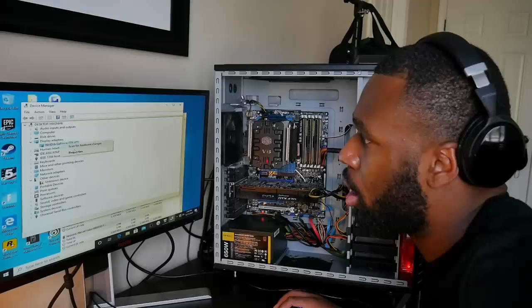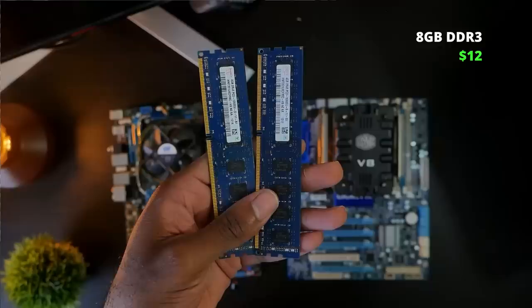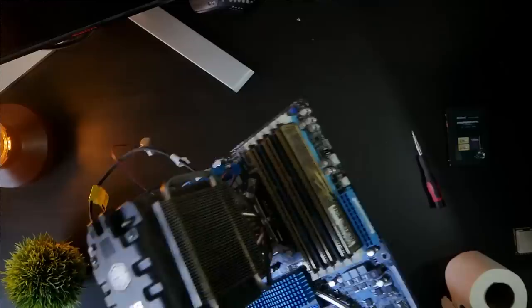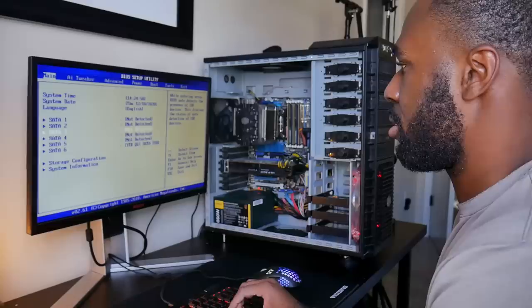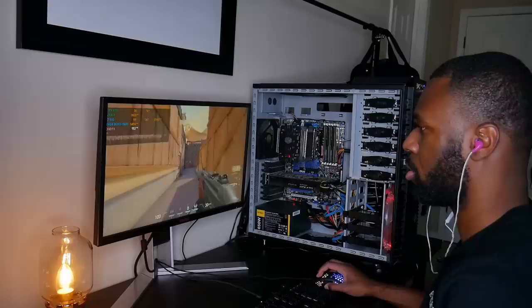No Code 43 — it worked! At this point Lazarus is functioning enough for us to actually get some testing done. However, Lazarus doesn't really meet the minimum requirements for Cyberpunk, so I upgraded a few things. We only had six gigs of RAM, so I threw in two four-gig sticks for about $12. I also picked up a 120 gig SSD for about $20 brand new, putting us at $32 total. I overclocked the RAM to 1600 MHz and left the CPU at stock because the cooler wasn't cooling the i7 adequately.